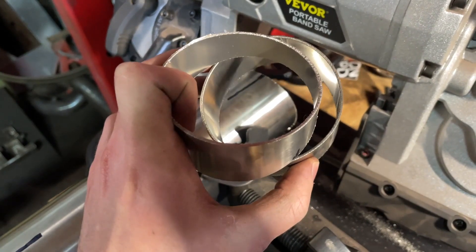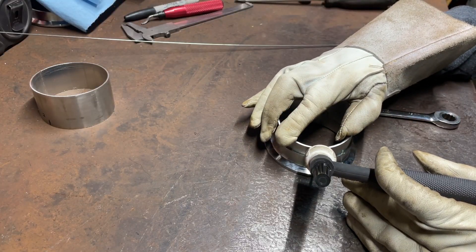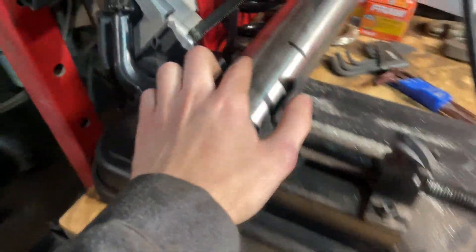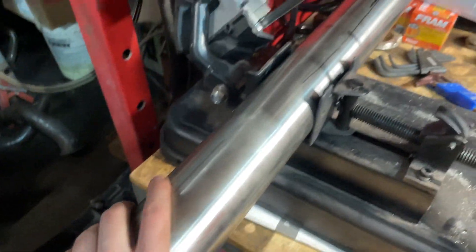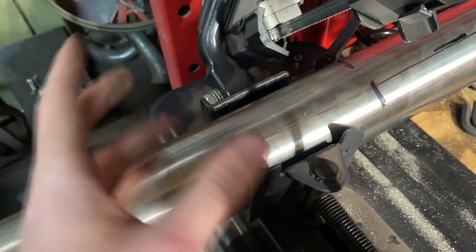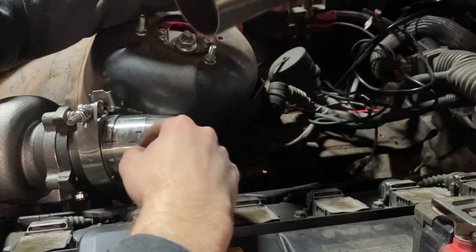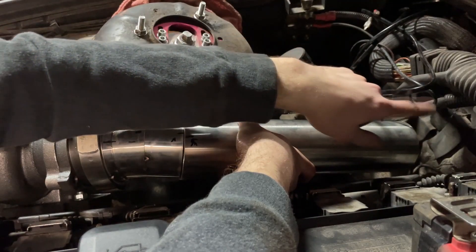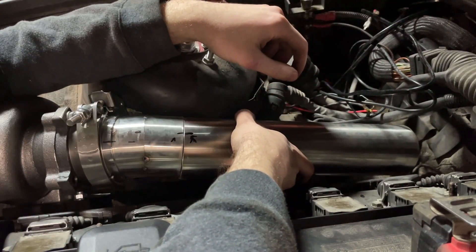I've marked this part here at about 30 to 32 inches, so I marked out 32 inches to be on the safe side and we're going to chop this and see how that fits. Then we'll start on the 90-degree section which is going to need pie cuts because I don't have any 90-degree bends unfortunately. I got this section bolted up with a nice down slope, and we'll make the 90 — or not necessarily a complete 90 — at the end there. Here's what we're working with so far — got the first section tack welded and it looks good.